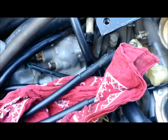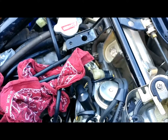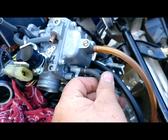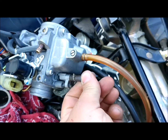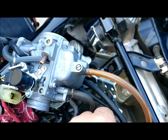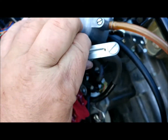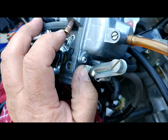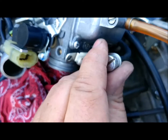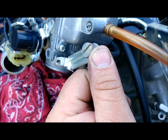I'm going to finish getting this coolant block mounted on the carburetor - there's just no way I'm going to be able to put it on there and film me doing it. Here's the coolant block and it goes right in here. See how it fits in there like that. And then your idle speed adjustment sits in here like that. So when you put the screw in, it sandwiches the coolant block in between the bracket for the idle speed control and then your adjustment. And then the other part just goes on this little boss here on the carburetor - this little raised portion there. I'm going to get that all bolted together and I'll show you what it looks like.